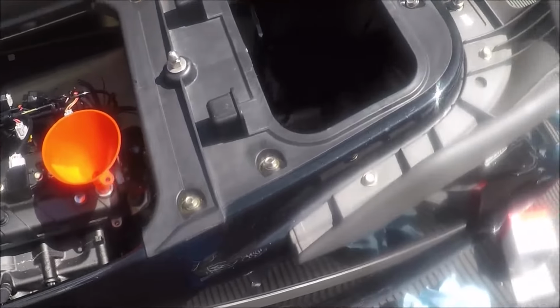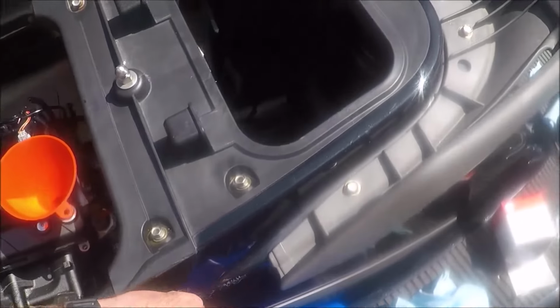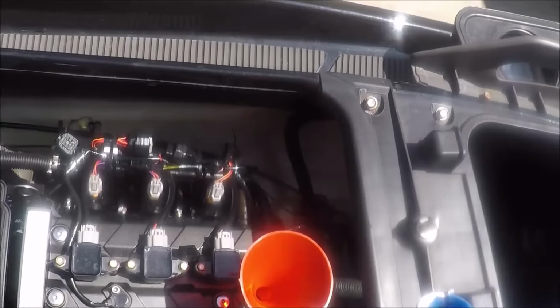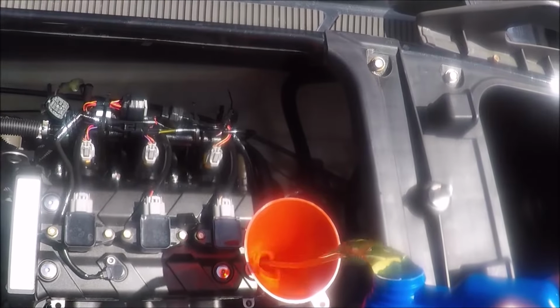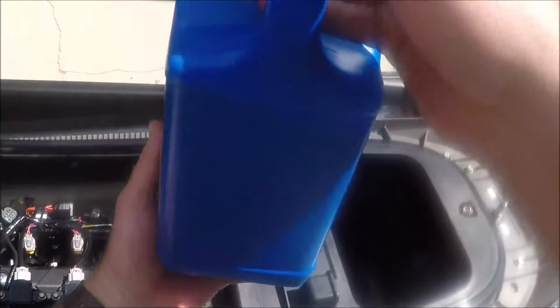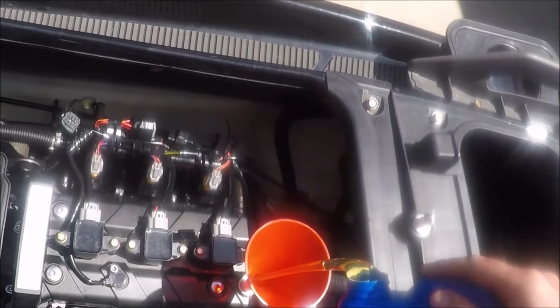It takes about 3.6 quarts, or 3.59 quarts, of oil. So basically a good starting point when you start checking is to do about 1.5 quarts in the top and 1.5 quarts in the bottom roughly, and then you can adjust it after you do your final oil checks there. And if you fill it too high, you can just use the extractor, clean the tube off your extractor, and just suck some of it back out.